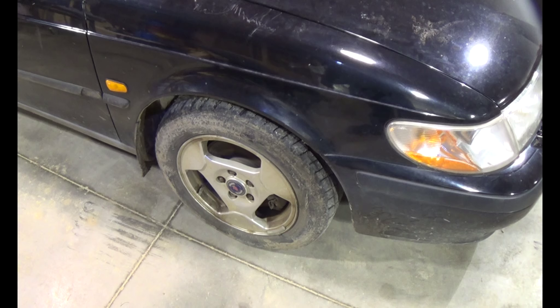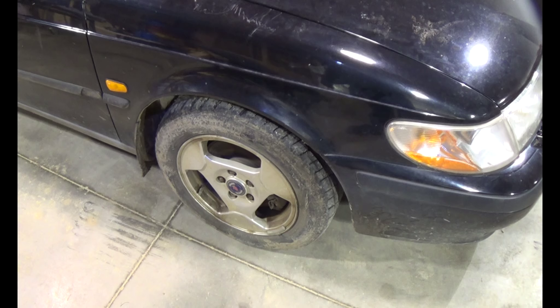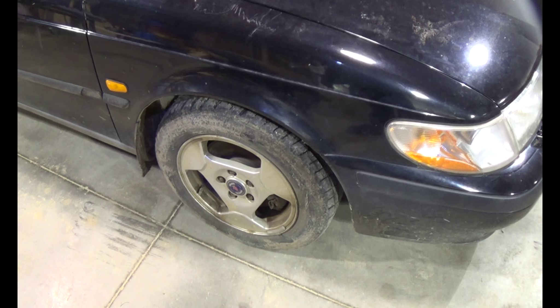I may just have to ask him if it's okay to jump on this tomorrow, because I may have to get him to take her car out of here. This is his daughter's — or daughter-in-law's — car. But I'm going to have to take that front wheel off, I almost guarantee it, because that drive shaft is in the way of getting to and getting out that alternator.